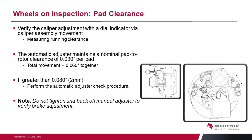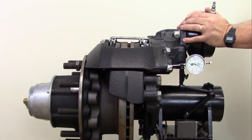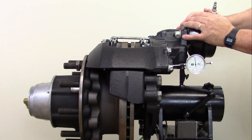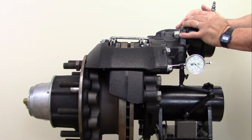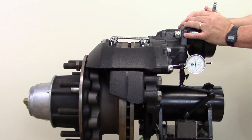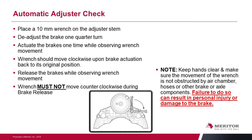We will show you here how we have done the clearance check — a little video showing it mounted onto the axle with the pin in place on the cap, and then we're just going to move that unit forward and back and get our total measurement. Again, we're looking for ideally 60 thou, but we'll allow up to 80 thou. If we have more than 80 thousandths of an inch, you want to check to make sure your automatic adjuster is functioning correctly.